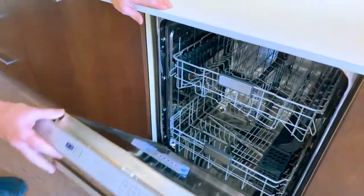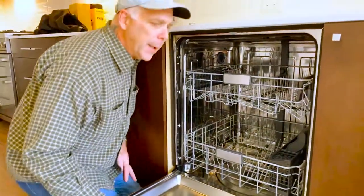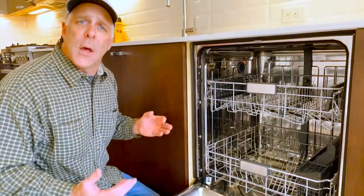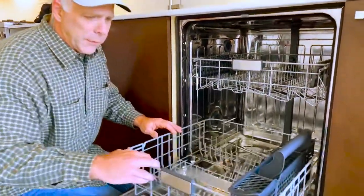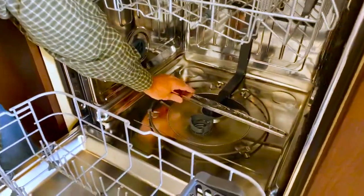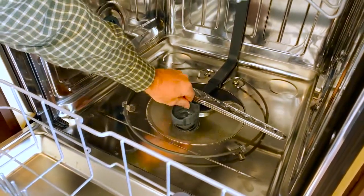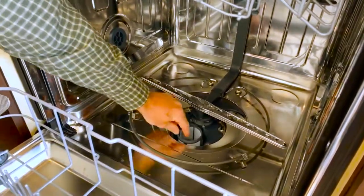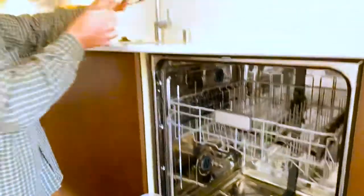In the dishwasher itself, there is a lot of literature to read in the manufacturer's guide, but I'd like to take an opportunity to give you a physical explanation of how to maintain the filter that is in the unit. This filtration system repeats itself between this Vertozone unit and the Bosch. Inside here is a small plastic that turns to the right. It pulls out, it pulls the screen out, and then the filter is accessible, which can be taken to the sink and cleaned.